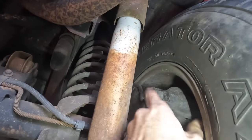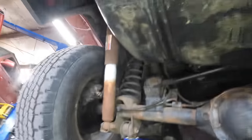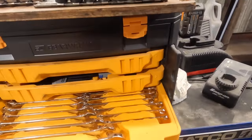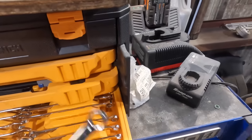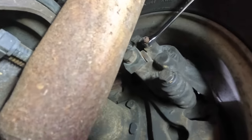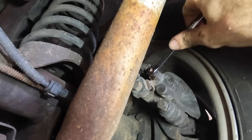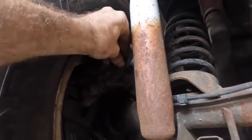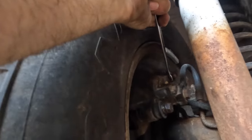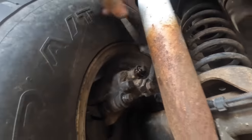Let's put a 10 millimeter — actually three-eighths — wrench on these bleeders and see if I can crack them open to get some fluid flow. If I can't get fluid flow, I'll probably have to put new calipers on it. That one cracks open. Let's check the other side — get a good bite so it doesn't slip. There we go, fluid is flowing. That's a good sign on both sides.